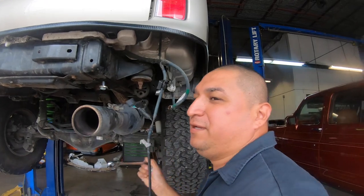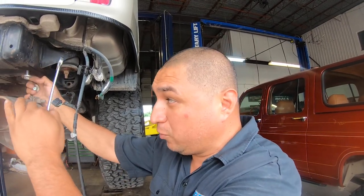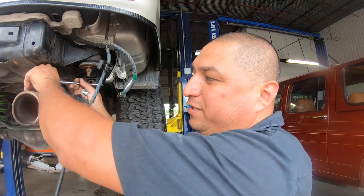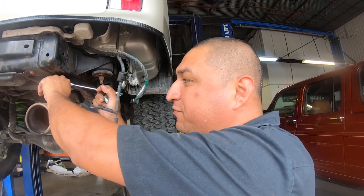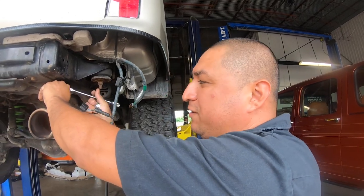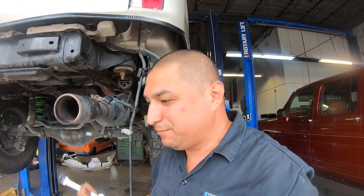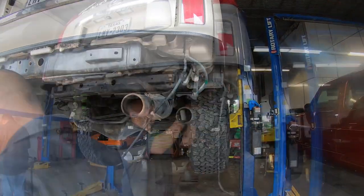But before you put the bracket, you gotta make sure the thread inside is clean or else you're gonna have trouble. I was trying to put the bracket, but it didn't wanna go in there because the thread inside is dirty. So what I gotta do is re-thread it first. Gotcha. So the bolt can thread in there. If not, you're gonna have a hard time with the bracket and the bolts. By the time, you're gonna be cussing.